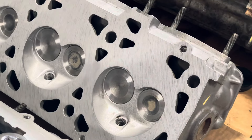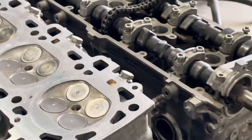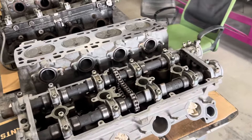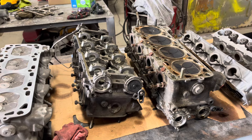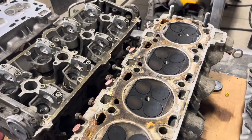Notice how this head has the swirl marks from the cutting tool. I don't know if that's normal or if I need to expect that. Comparing to this head, I don't know if these heads right here have been resurfaced. I think it's probably prudent to have them checked, pulled apart, and new valve guides put in. I'll get the heads back, blast them, and might do the same with this set — maybe even utilize them on that other M28.41 motor that I've got a lead on buying.